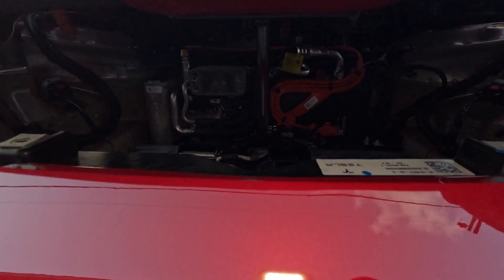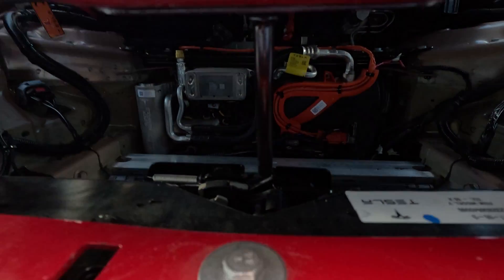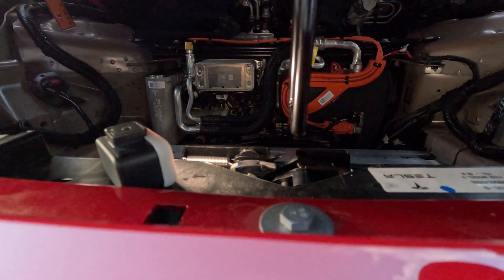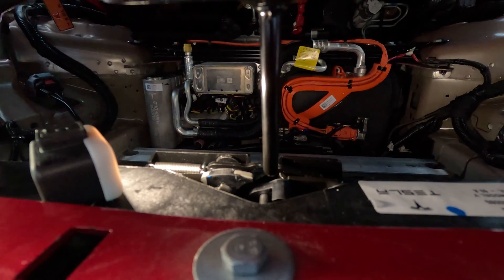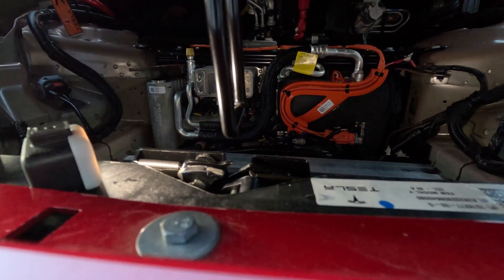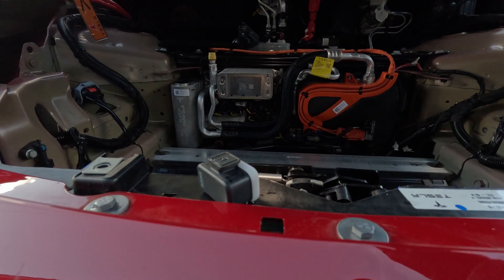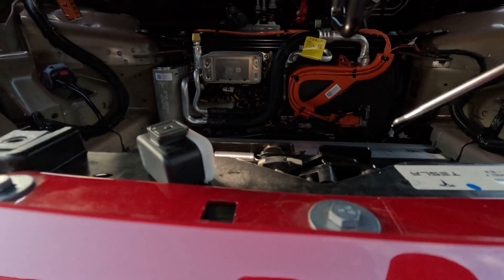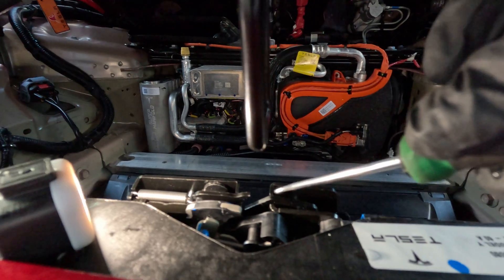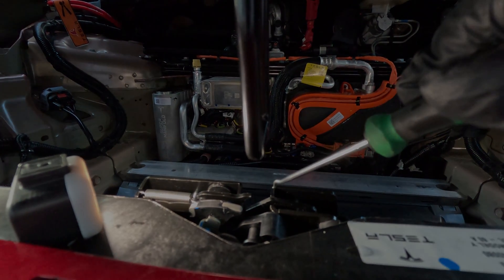Before you reinstall everything, triple check that your hood latch is aligned correctly. You can see here where the hood latch is coming down and it is not making contact with any parts of the latch or the auto frunk body — that is very important. Let's take a look as I bring this hood down: the latching mechanism is going to touch the lever, which is totally fine, but it's not hitting the edge of this body. And that's it — hope this video was helpful. Until next time.